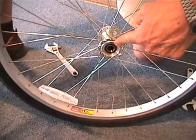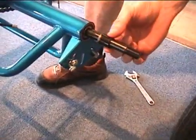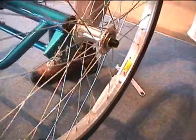The other side of the bike will have 2 sealed bearings inside its hub. When you slip it on the axle, make sure the spacer is on first, followed by the wheel, then the washers, and the final locking nut.